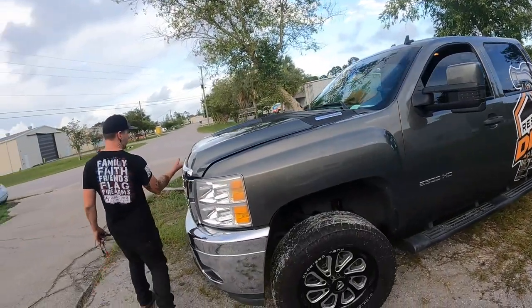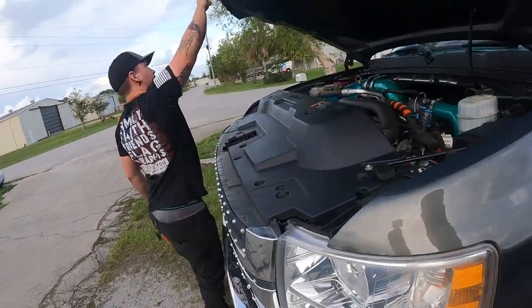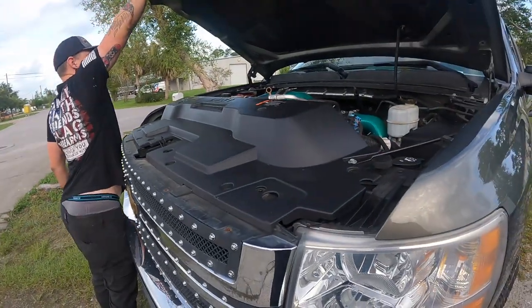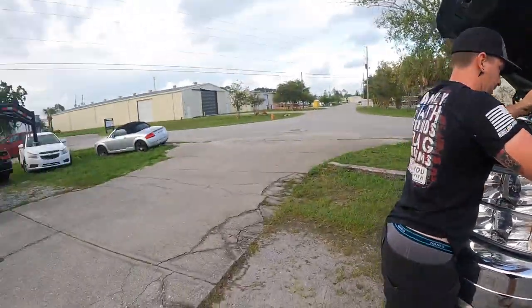We're gonna try this test on Rory's truck, see if we get similar results on his truck. The thing's pretty impressive though, like the options it has. It has all kinds of different modes you can run through, like hold it at idle, lights on, all accessories on. It shows you how your charging system is working, how well your battery's holding the charge, and how well it holds a load with everything on. So it's kind of cool.